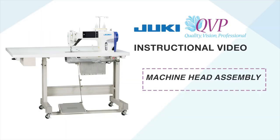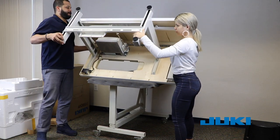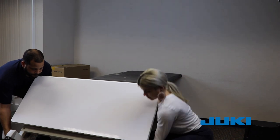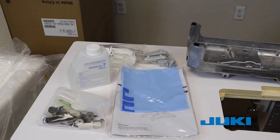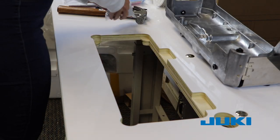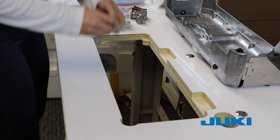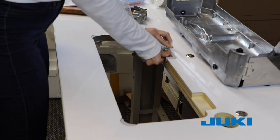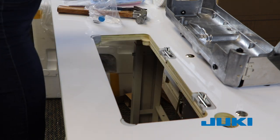Machine head assembly. If you are working on the floor, roll the table forward onto its face and not onto the leaf as this will damage the leaf hinge. Now that the table is upright, unpack the remaining pieces from the styrofoam packaging. From the small bag of parts, find the 2 small grey corner inserts, 2 black corner pads, and 2 grey with metal machine hinges. The 2 grey corner pieces go in the front opening matching the cutouts already in the top. The 2 black pieces go on the back to the tabs. And the machine hinge pieces go into the rectangle openings in the back side as shown here.